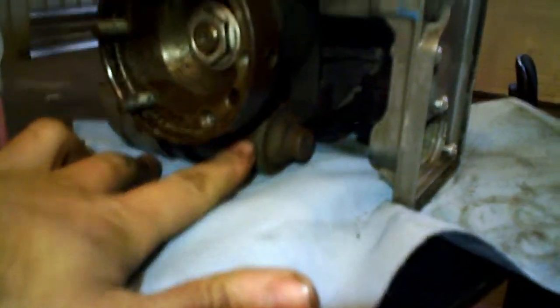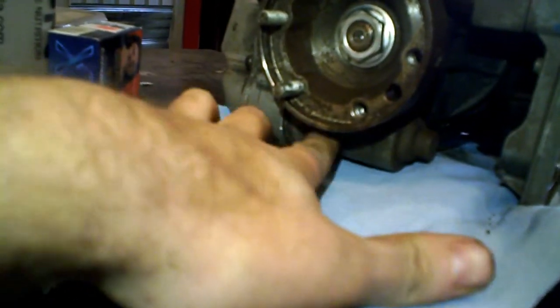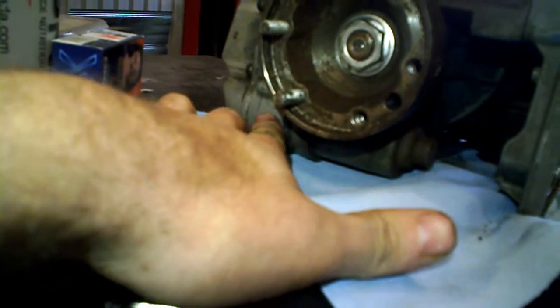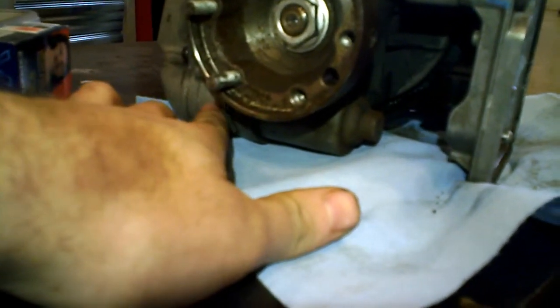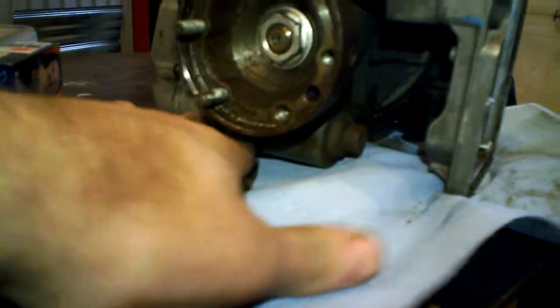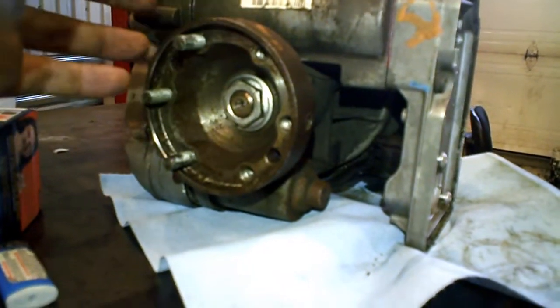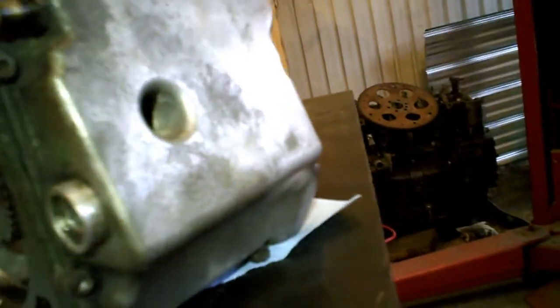The thing that can happen also is this oil pump here also has two O-rings here to seal, because obviously it's creating some oil pressure, and if the O-rings wear out, you know what will happen. It will just leak out here under the differential, and you will not be able to create some oil pressure, so the clutch pack will not compress, and your center differential will not work properly either. Now, these are the things that can go wrong that are electrical and oil pressure related.